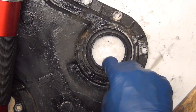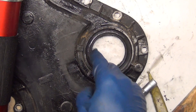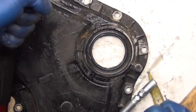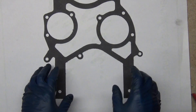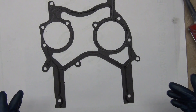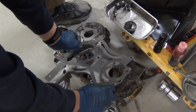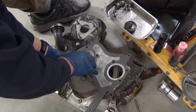The most important part is wherever you have something coming into the seal — in this case at the harmonic balancer. Put grease on the outside so that lip is really lubed up and can't get torn. It'll slip as opposed to grip and tear. Know that this side is going against the timing cover — I've double-checked it. A lot of gaskets come with this sticky coating already on them. The nice thing about it is it'll hold the gasket in place so your bolts will line up and you don't hit gasket when you're trying to thread your bolts through the holes into the block.